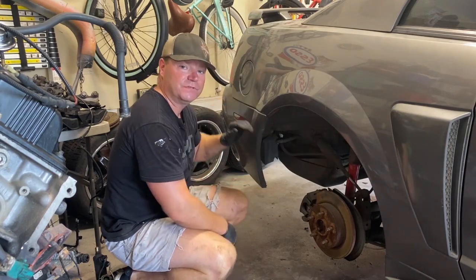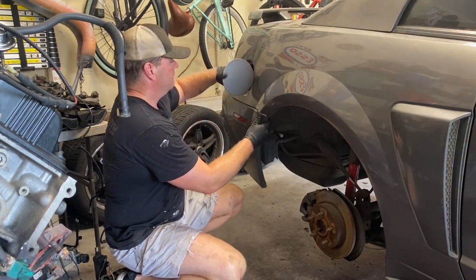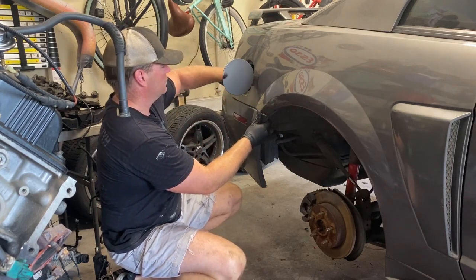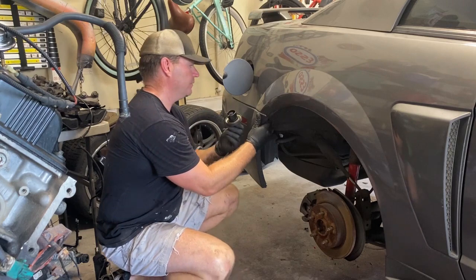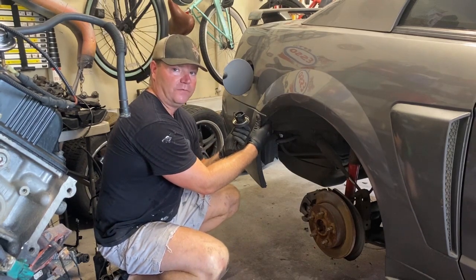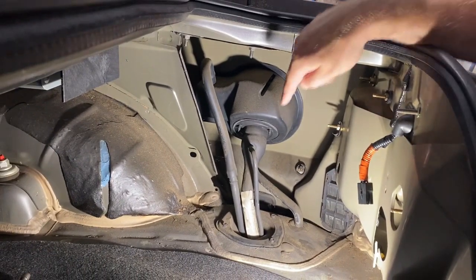For this episode we're going to concentrate on getting that tank down, fuel neck off, and fuel filter. The key's in it — how unusual. We'll start right here by opening up the gas tank to relieve any pressure, and let's get it off. You got to get back into the trunk to get to this.